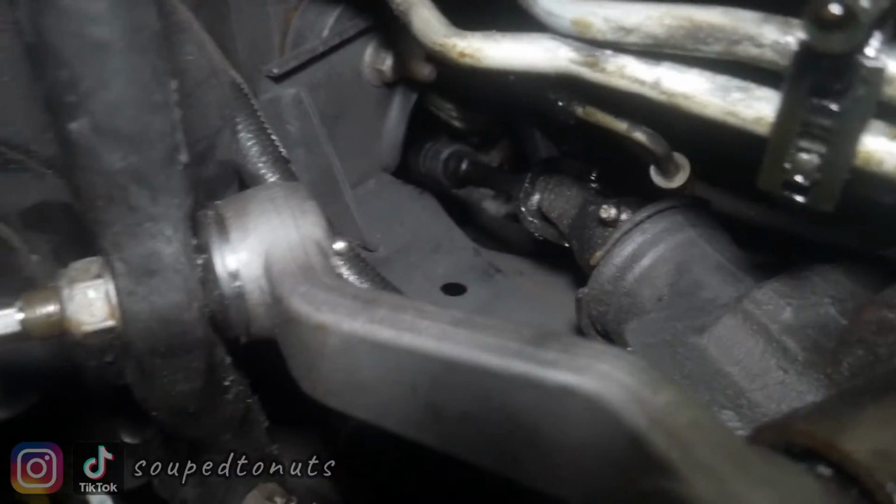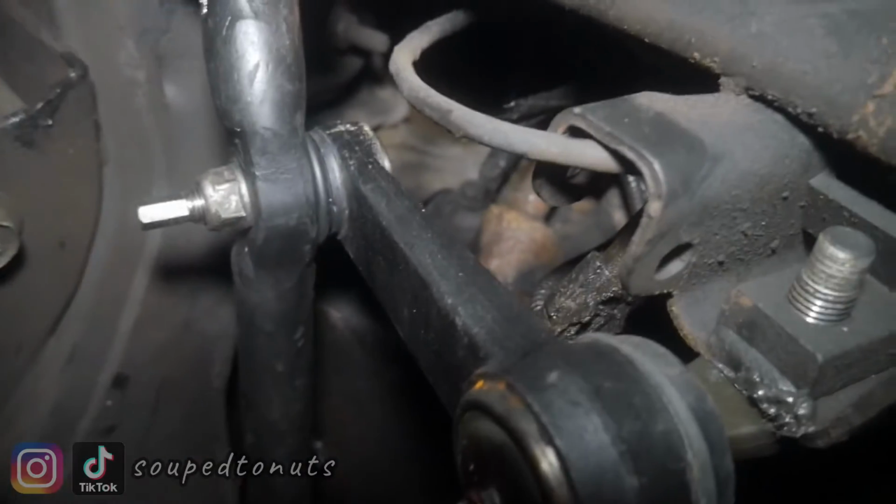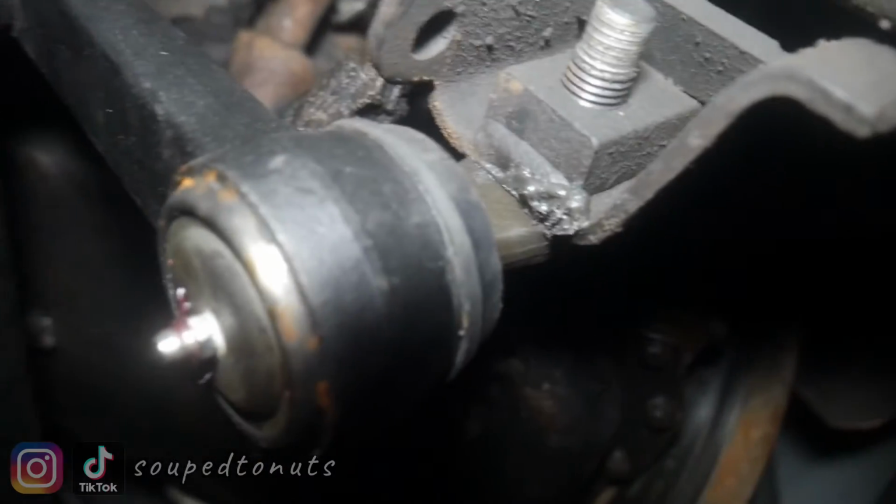All right, so there's the one arm here that I replaced. This is the new guy on there. I don't know if you can see on camera, there's a grease fitting on top of that joint there. Got it all filled up with grease. And here's the other arm. You can see where it bolts right there, that nut. That's the arm, and there's the grease fitting right on the bottom here. So I got all that bolted up and got that grease packed out too. I got both arms on, and they're good to go. And obviously the truck's jacked down onto the ground as well. And I'm all cleaned up here.